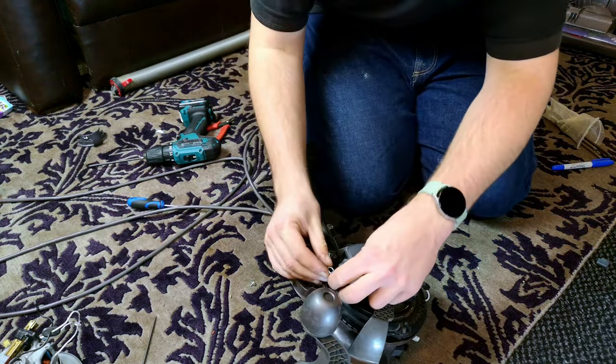Our cog is too far in, so we now have to play the game of taking it on and off and adjusting that little white cog until it sits properly and the whole thing pivots. When that little clear cog is in and done, you will have a nice satisfying clunk down and this bit moves very freely. Then careful of our loom - it should click up, and that's actually better than a lot of DC40s. Now for the brush roll loom, which isn't a barrel of laughs either. You have to do a lot of cable grommeting.